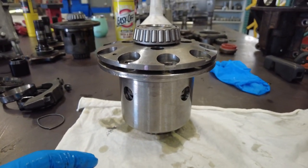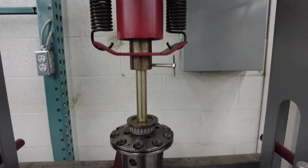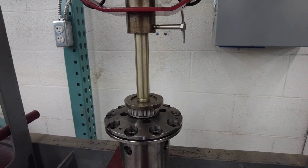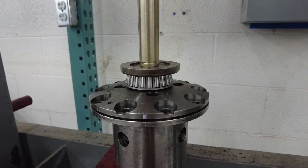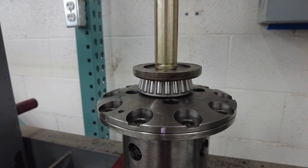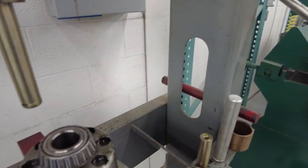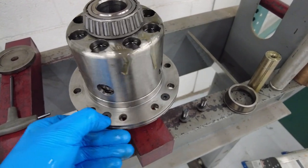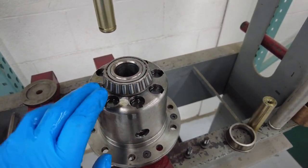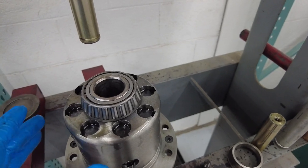We've got these little pink marks here and they line up — we are ready to put these four screws in that hold this clamp down while the ring gear is off. In order to do that we're going to have to compress the big Belleville springs. Got everything lined up and on the press — this shouldn't take much pressure, so if you get too much resistance you probably got stuck on something and need to double check that everything's lining up right. Squished down — let's grab the bolts, put those in, and we'll be ready to rock.